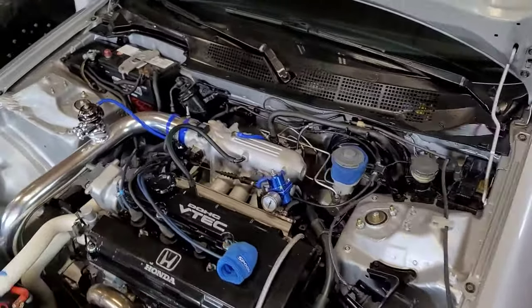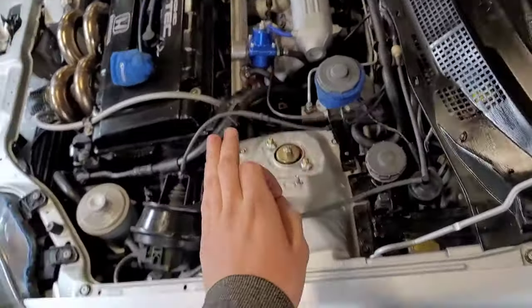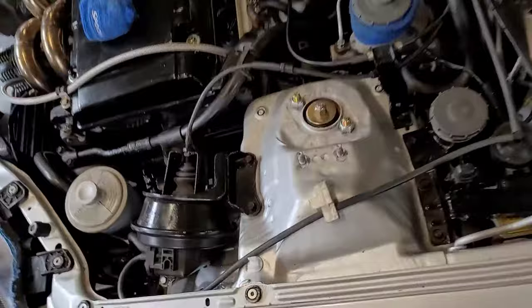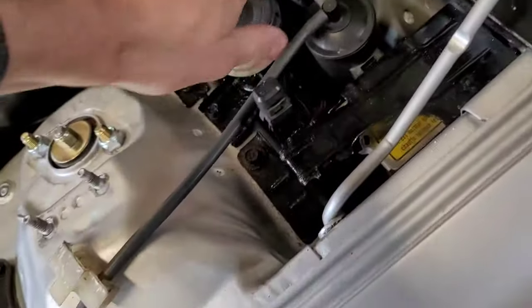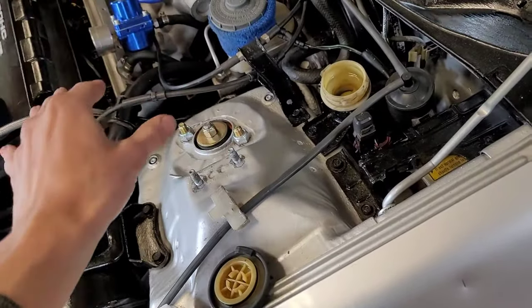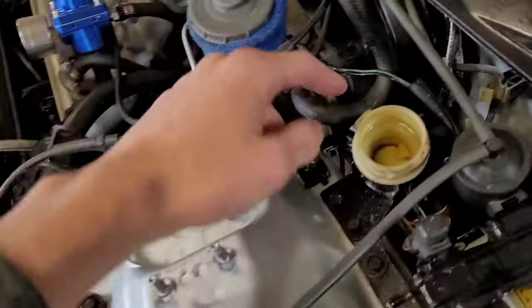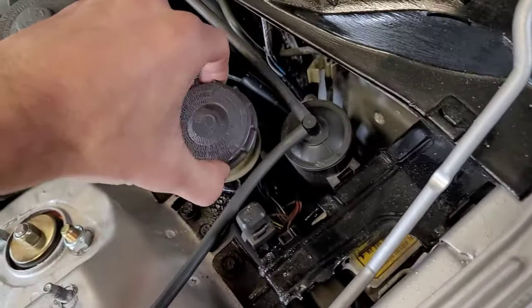After pumping it a good few times, it doesn't feel exactly like your brakes — it's not quite as much pressure — but you'll just have a nice even flow back and forth. Then you just go over, close your line, take out your bottle. On the last push, push the clutch to the floor and just leave it there — it'll hold itself. Close the thing, come over here, fill up your reservoir, put the cap back on, and push the pedal a few times. Check the level — looks good. Pump it a few more times and that's it. That's it for bleeding the clutch. Pretty straightforward, simple.